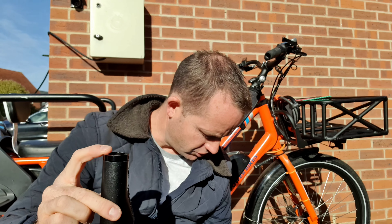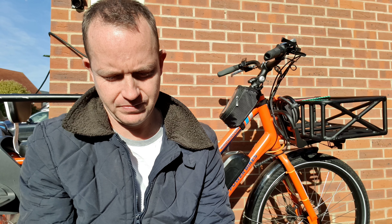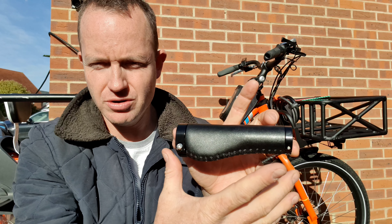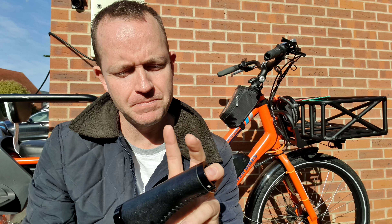Another thing I like about these grips is they're not friction grips — they've got a tiny little allen key bolt on each side, one there and one there, and you secure those to hold the grip onto your handlebar. Later down the road, if you want to put a phone holder on or move things around, you just undo these two bolts and the grips slide off really easily. Taking friction handlebar grips off is difficult because they're not supposed to come off easily, so these are a really handy upgrade.